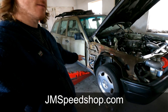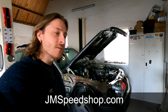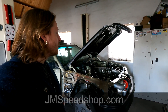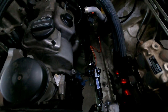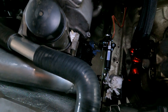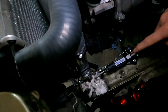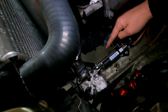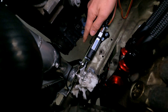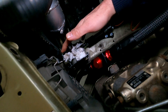The last things I need to do is connect the level valve to the hydraulic lines, and then I can test the pump. You can see I have installed the level valve and there's an actuator in between — this is also from the last video. The connection down there is connected to the stabilizer bar; if it moves, it will move this lever up and down.